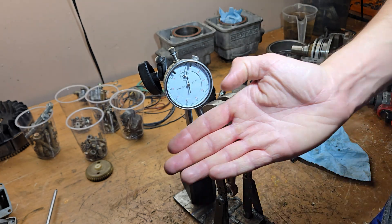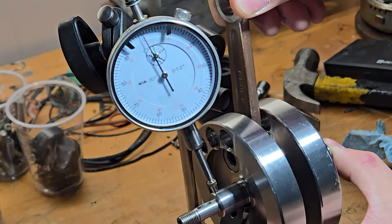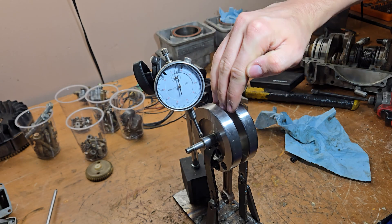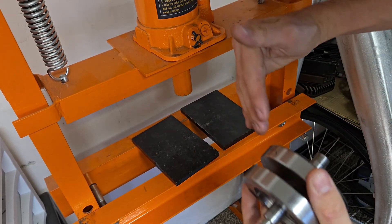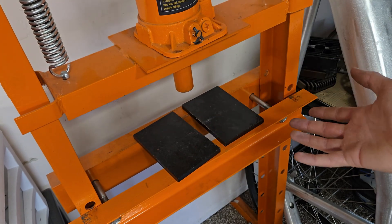So the shaft is slanted this way, which means this web is slanted. Let's flip this over — wow, seven and a half thousandths. It's the same spot as well. Just wedge in there or something, split this apart. You can use a hammer and a wedge, use a wedge in there and hammer that. Or you can use a hydraulic press or a vice or something.